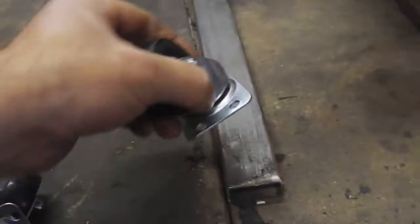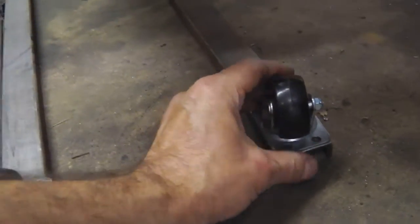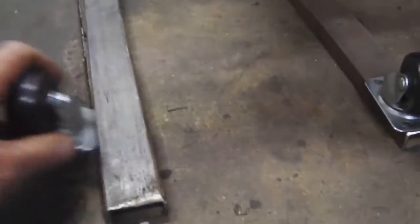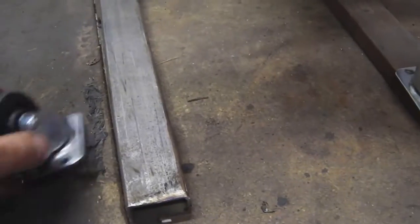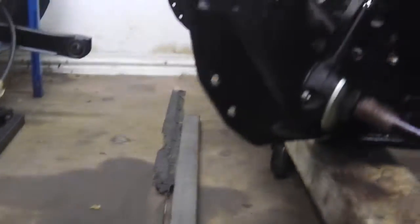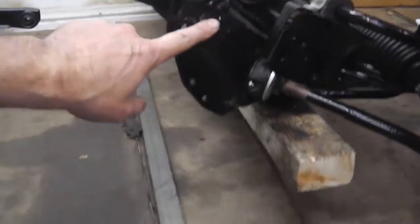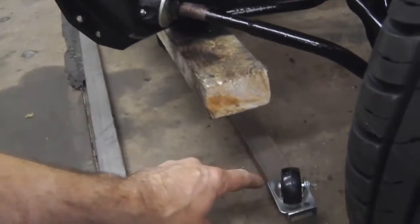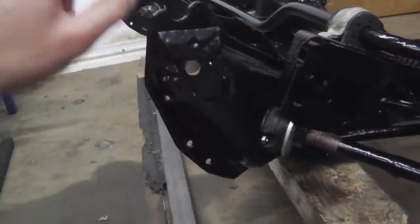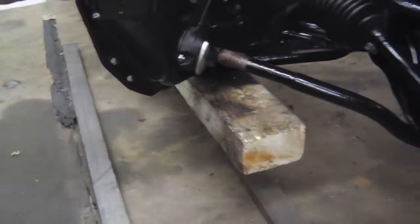We've got some little wheels here. We're going to stick them on there like that. We're going to build a square frame first with this flat box section, and then I'm going to put a triangle shape up to this. I'm going to brace that as a box section, then a triangle with a bolt through there on both sides, and that'll create a stable dolly hopefully.